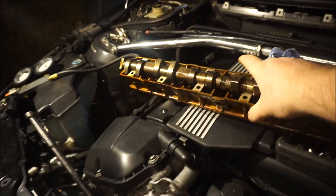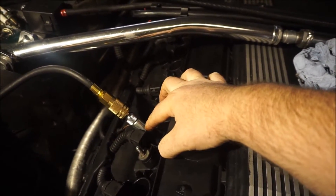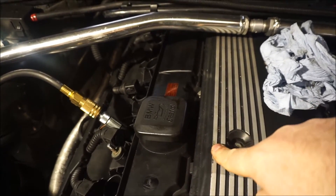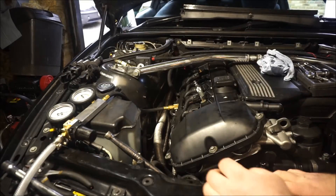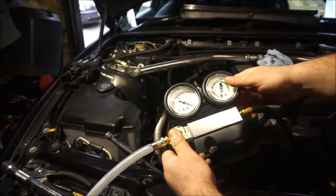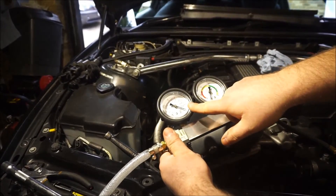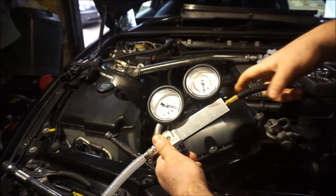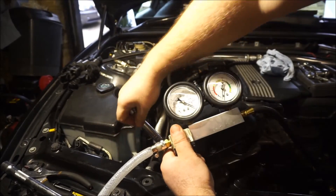That's why when you're not setting your top dead center properly and you're applying pressure, a valve might be open pushing back to the intake manifold. So here's how to do the leak down test correctly on the M54. Before you hook this up to cylinder number two, start your compressor, build pressure to 100 psi - that will show you zero leakage because the valve is closed. But you still need to properly set your top dead center.